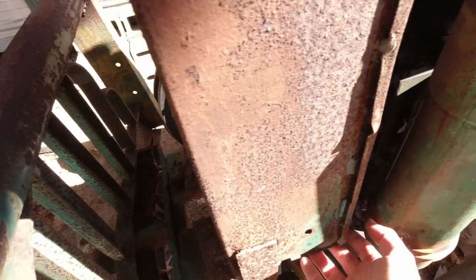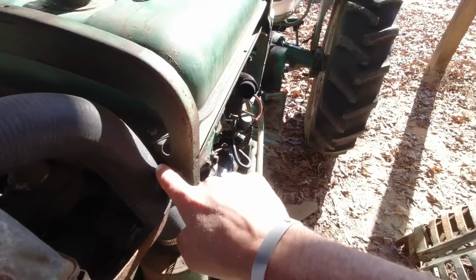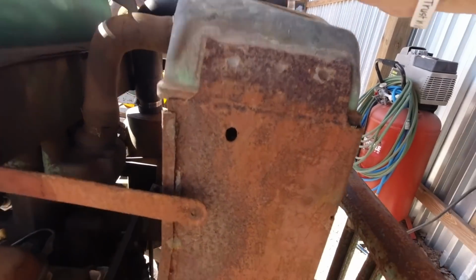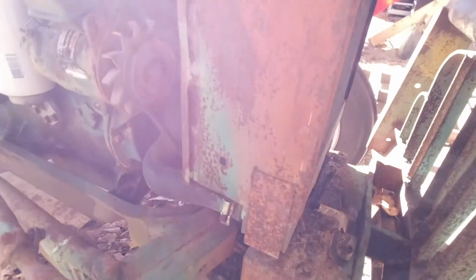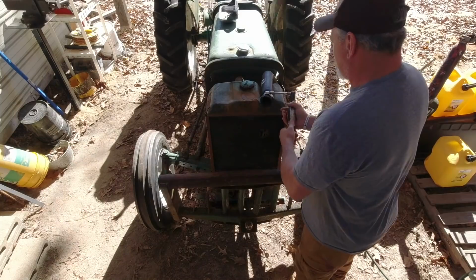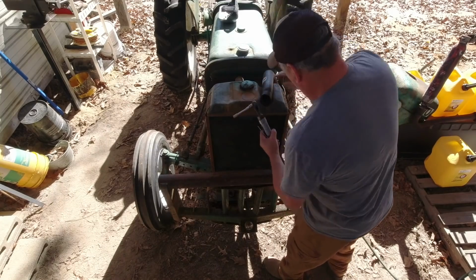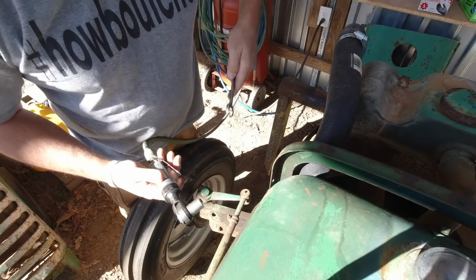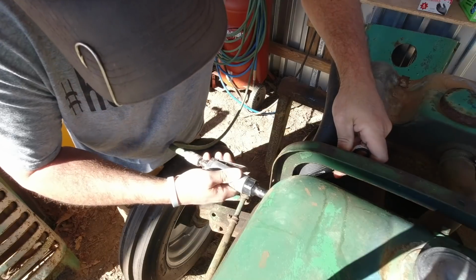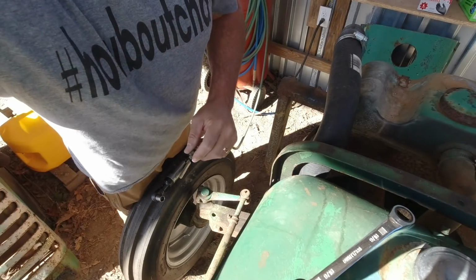So now I'm going to look to see how I can take this off. This is an easy part here. That's just one bolt over here. Take the hoses off here and here and see, maybe it comes off underneath the bottom here. I'll check all that stuff. Take this one loose here first. Now I've got this 9/16 bracket holding this thing on both sides, so I'll take it off here. Try not to lose it. Put it in my little container over here.